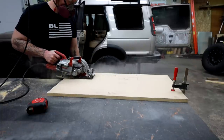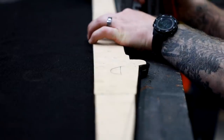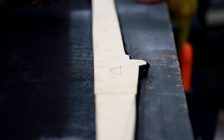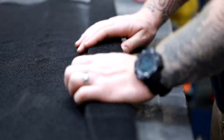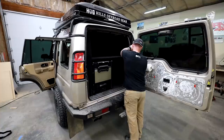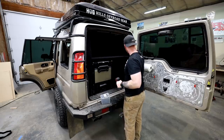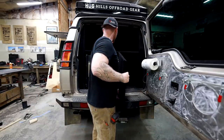I chose this three-quarter-inch MDF for a reason - it's really rigid, really strong, and it's got a smooth finish. It's going to look good with carpet going over the top of it, and it's something I'm very familiar and comfortable with. I have a little trick I like to do when I work with this stuff: I add carpet where I double-seam all the edges in order to keep you from seeing the staples. I staple an edge, spray adhesive, roll it over the adhesive, and then at the very end I spray adhesive over that edge and double-overlap it to make it so you don't see any staples. I think it gives it a really nice clean finish.